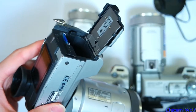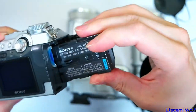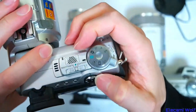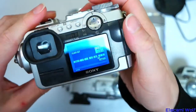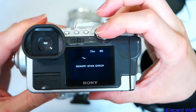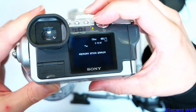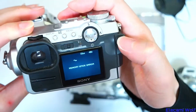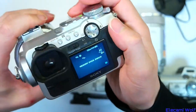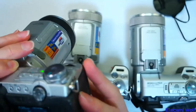I have charged up some batteries with a power supply. These cameras suffered from failures of the sensor — the CCD — and Sony was replacing them for free. This one has a memory stick that's no good, and the image sensor doesn't work. There's no response to light at all, so let's try the others.